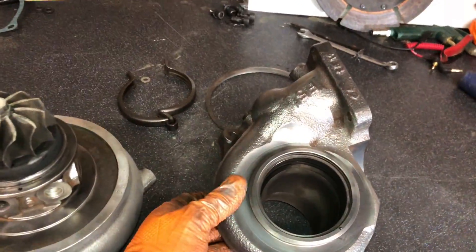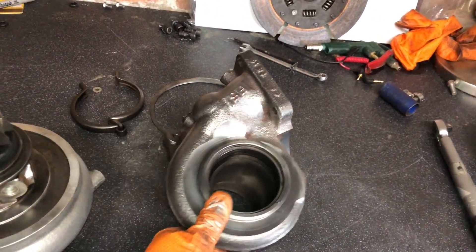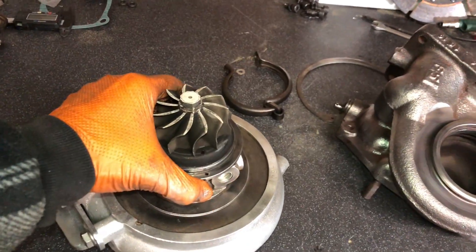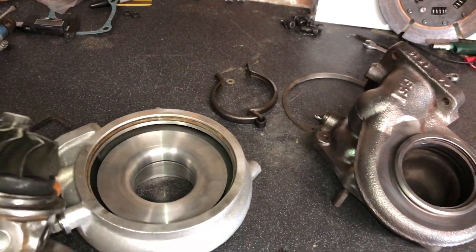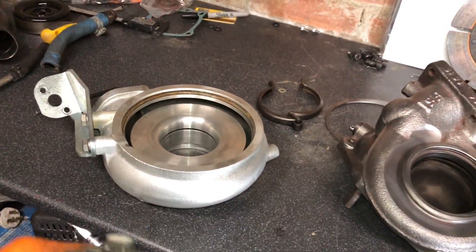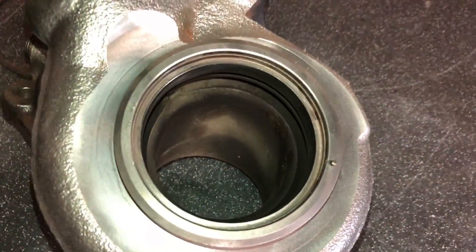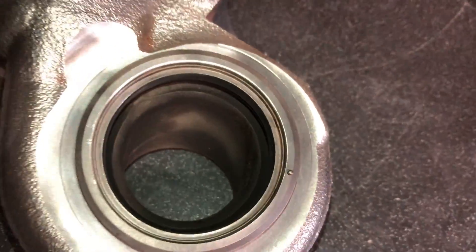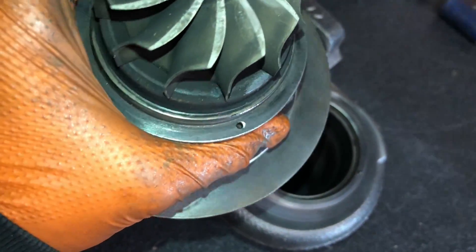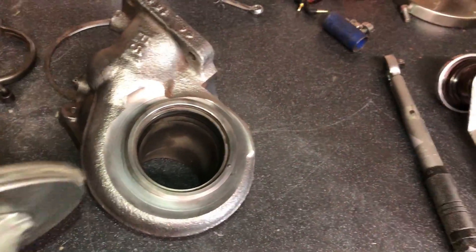There you go, I've just cleaned up all the exhaust housing - see how nicely that's come up, it's like new. It's not done many miles since it's been rebuilt and it's been bead-blasted at some point. You can see the compressor side's all been cleaned up now as well, and inside the compressor housing also. The nice thing about these exhaust housings and compressor housings is they've got a notch that you can line up the core with - the core has a hole in there - so you're never going to get out of sync.